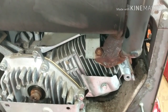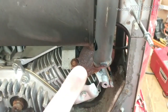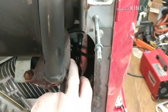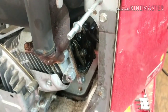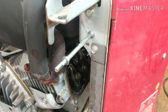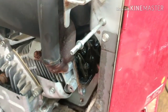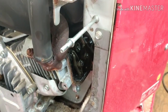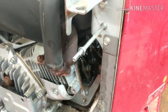Right now the cylinder is at bottom dead center. What I did was take the spark plug out and move it up to top dead center — you know that because you'll have play in the rockers. Then I popped the rockers off. The easy way to do this: if you push the rockers out of the way, the valves are going to be completely shut, then you move the piston all the way down to bottom dead center and pressurize it. If you're at top dead center and just a little bit off when you pressurize it, the leak down tester can push the piston and rotate everything back down and you'll have to start over.